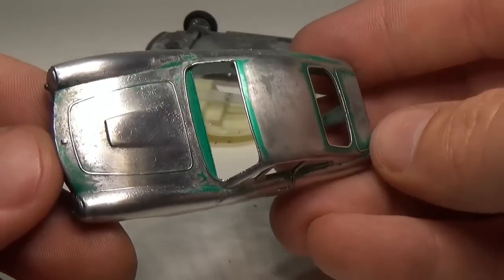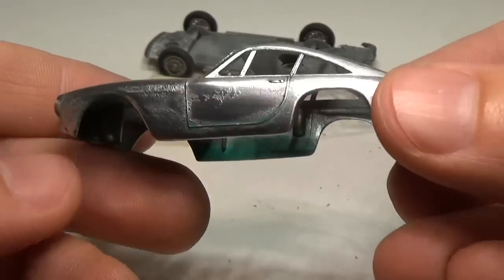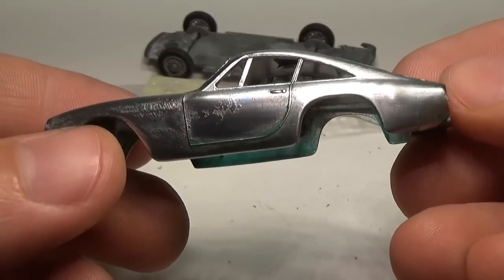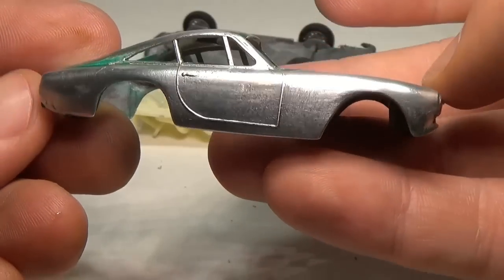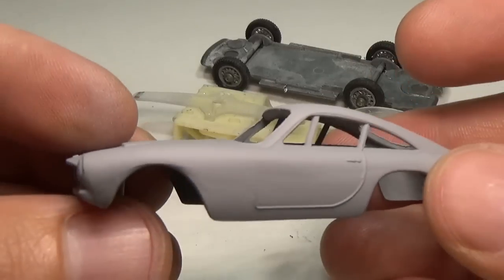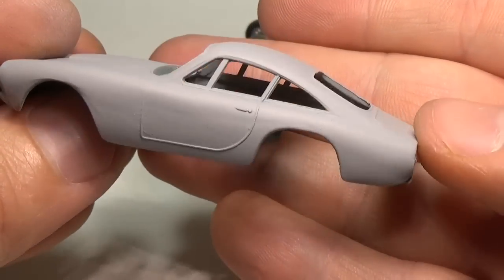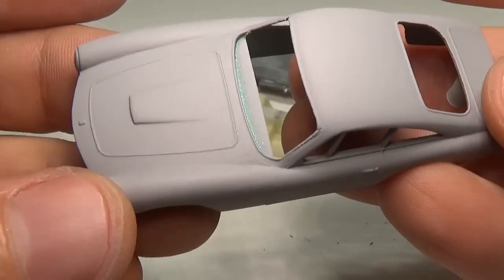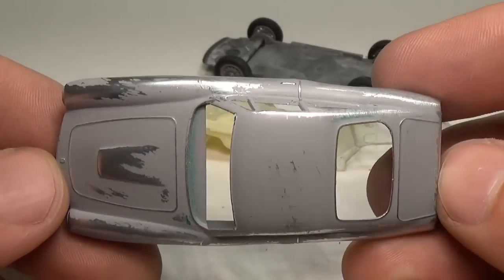Most of the paint is removed easily with sandpaper, so maybe the chemicals had more of an effect than I originally thought. With the paint mostly gone and the body sanded I can go ahead and apply my first coat of primer. This will tell me if I have missed any areas on the car. With the primer dry I can inspect the car. There are several places that need more sanding and cleaning, so I'll tend to those issues and then spray another coat of primer and inspect the car again.